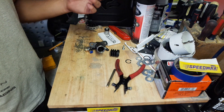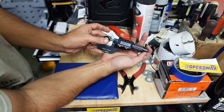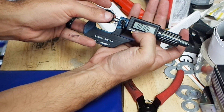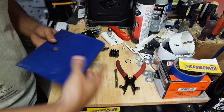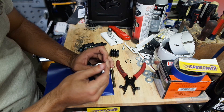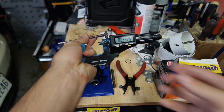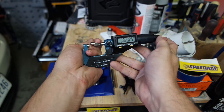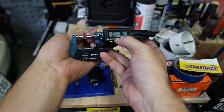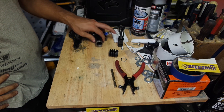We want to make sure we can fit our piston in there. We're looking right around 4 millimeters of wall thickness, and the bore is exactly at 0.81. Now we'll take our smallest telescoping gauge — 3/4 to 1 and 1/4 inch range — lock that measurement in place, then use our micrometer to figure out the measurement. We're looking at 0.84305 — right around 33 thousandths of an inch in terms of piston-to-wall clearance. Now we actually have to get this fitted on the lathe.